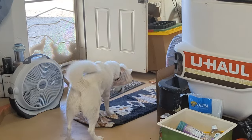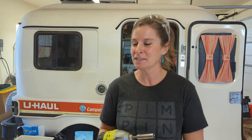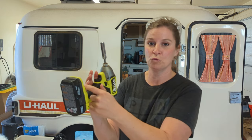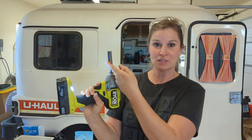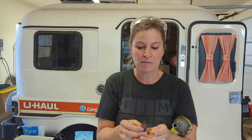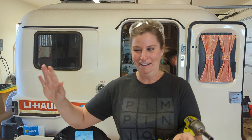When you do decide to change these out, make sure you have an impact wrench — I should have started with this from the very beginning. It gives you the right pressure so you don't break the bolts, and it also jiggles and rattles the rust loose so you have a higher probability of getting them off easier. I had two that were a major problem and I had to use the angle grinder — I had to finish grinding off the top to be able to push the bolt through because hand-ratcheting had fused them.